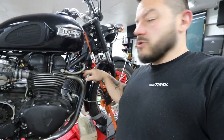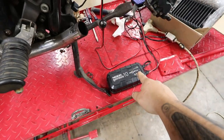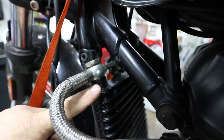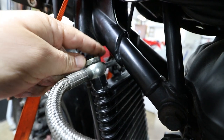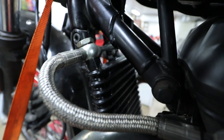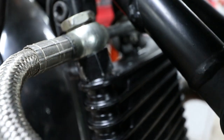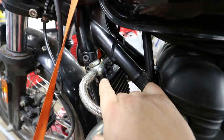Next on the agenda is getting this cooler out. I checked on the battery and it shows green, so we're good there. These are designed so you can put a wrench on the part that doesn't spin — it's welded — and then put the socket on the banjo bolt. I already broke it loose. I think what the previous owner was doing was cranking on the top piece, and then everything twisted and cracked right there at the cooler. You can see how it's bent and broken right there — just leaking at the cooler.